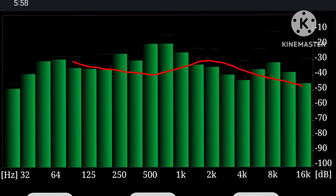If I'm using an RTA, I sit in the driver's seat — or I put the mic in the driver's seat — and then I set off to the side, maybe outside the vehicle. I try to get each speaker producing a relatively flat or at least smooth line in the RTA playing brown noise on the stereo. Once I get all the speakers individually making a nice smooth-ish EQ at the driver's seat, that's important. You're not EQing for what's coming out of the system; you're EQing for what's going into your ears, which is the mic.